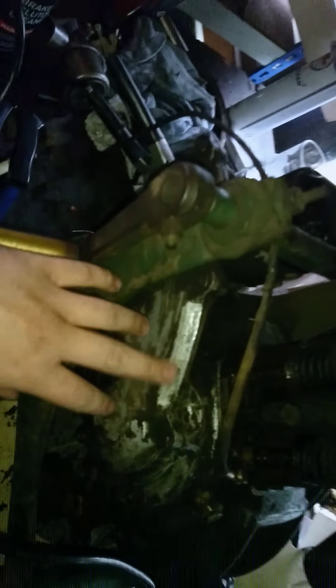Your head gasket's been off and re-annealed. Your valves have been re-lapped in — you can see that in there. It's also been given a bit of a decoke as well, and I'm going to be giving it a bit of a clean.